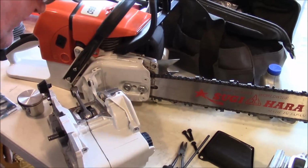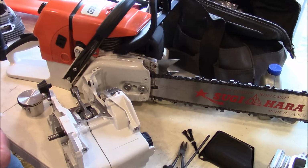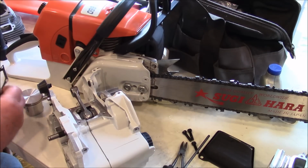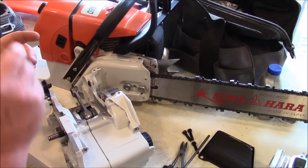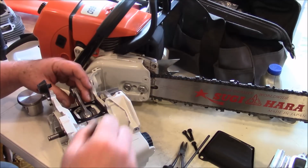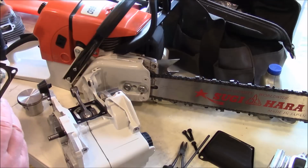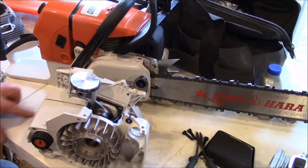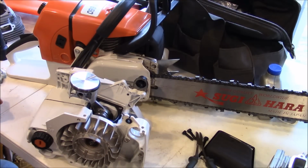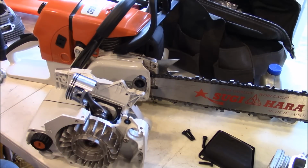I guess another tech tip is to make sure you remember to put your base gasket on before you put your piston on, because the gasket will not fit over the top of the piston. Second thing is this, there's that raised area that goes to the cylinder side, not to the case side. That guy goes right in there. Now I pulled this one out because I'd already crimped it, and it looked like it had been doing its job quite well. I kind of like these things, these metal gaskets. I basically just slide that back. I put the wrist pin clip in first on the side that I'm going to push to, and then get a second one in on, obviously, the other side.